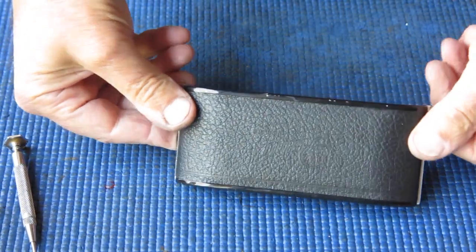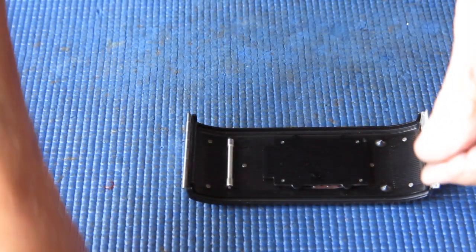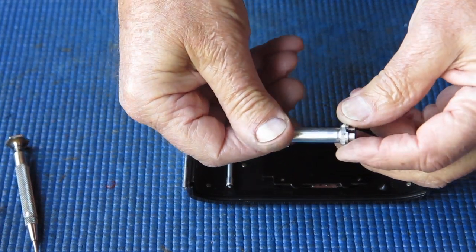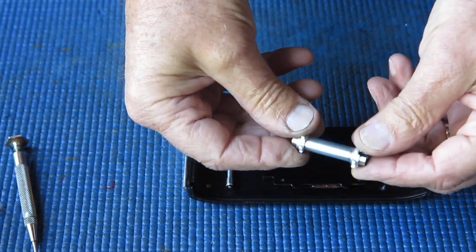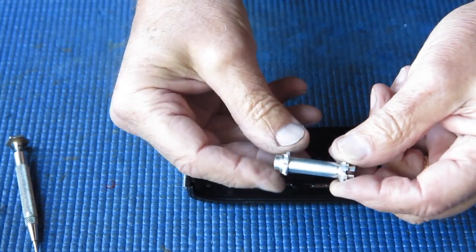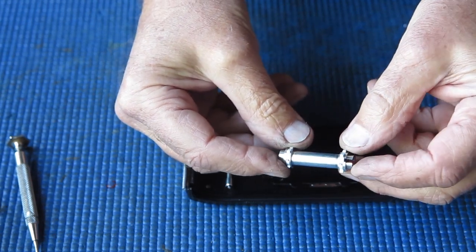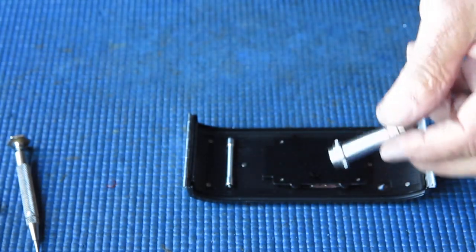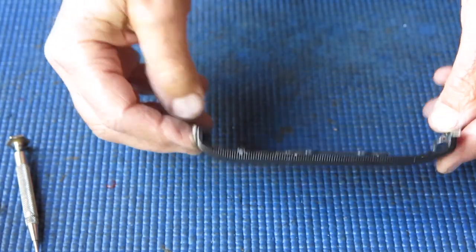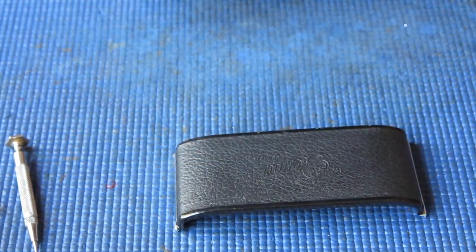There we go, you'd hardly know. And that had obviously been pushed in far enough that it had actually run on those sprocket shaft, the teeth had actually been rubbing into it. I'm looking to see if there's any damage to them. I don't think there would be. No. They'd just been milling a tiny slot in here as the shaft revolved. Interesting, wasn't expecting to find that.